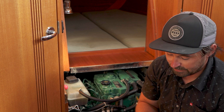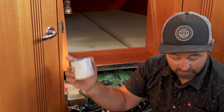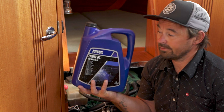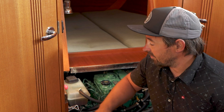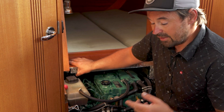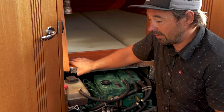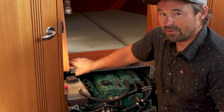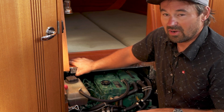Other things we've got: a new oil filter — that's a genuine oil filter from Volvo, which we always use — and some oil, again genuine Volvo oil for a Volvo engine. I'm not going to tell you what to use on your boat; your manual will tell you what grade of oil you can use. I'd suggest you use the right grade and a high quality oil. Oil wears out and gets thinner, and when the engine warms up you might not get quite the pressure you want into the bearings, and you could get a low pressure alarm.